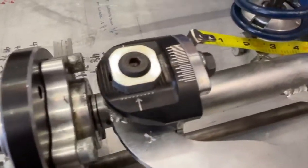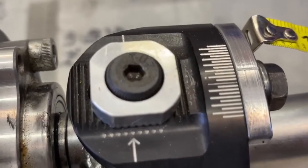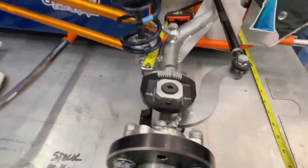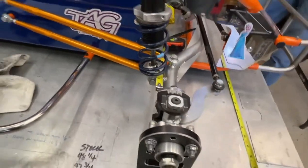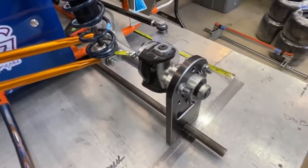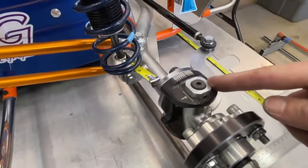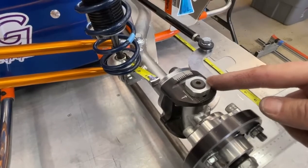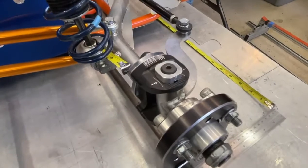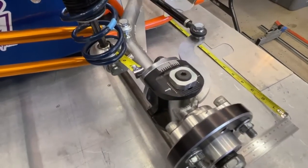There are slots that you can put it in, so we're calling that one slot over, and that's number three - so that'd be one and three. But we really want three degrees. The thing I have to say here is these blocks are never that accurate. If you say that's one slot three and you go to your other car, it's going to be two-two, or one-four - it's never going to be the same number.